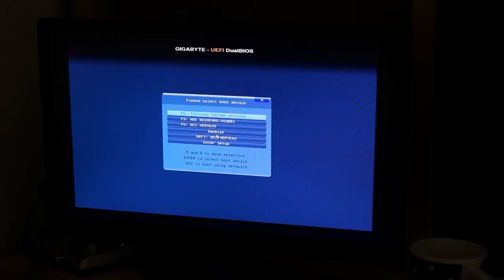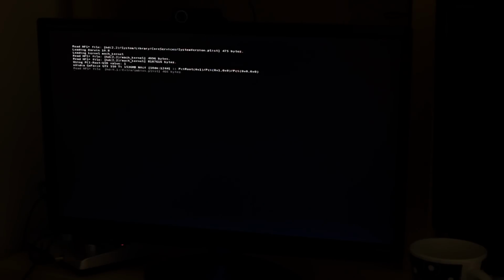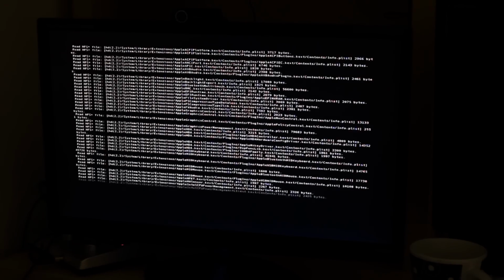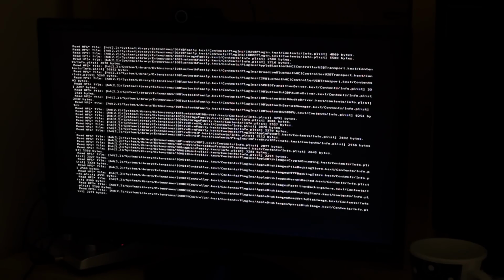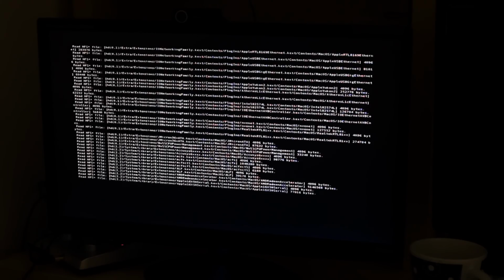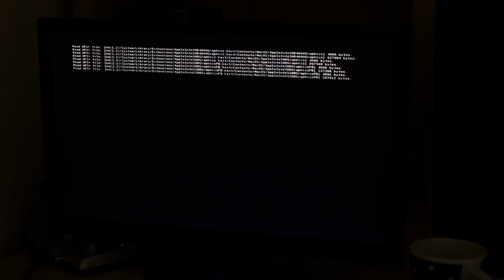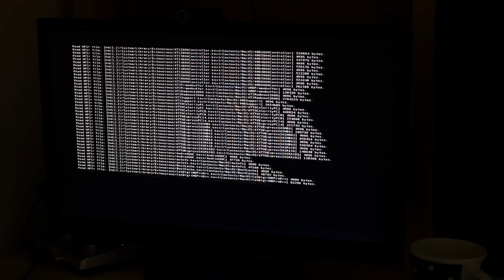Right everyone, that stayed grey screen and did nothing, so I'm just restarting the computer again now. I'm going to boot again, but this time I'm going to use -x -v, so I'm going to type -x space -v, and we're going to try it like that instead. I'm sure it just booted before. I could be wrong. I haven't done it for a while. So it's good that actually happened, because it might happen to you. I'm sure sometimes it actually does come on. I do know once I've installed MultiBeast in a minute and that it works sweet then, apart from the graphics glitches.